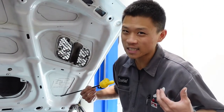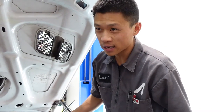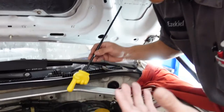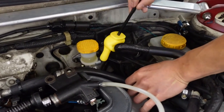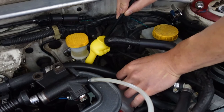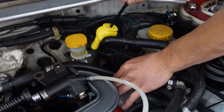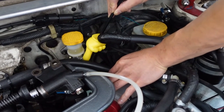What happened to me last time, which may be happening to you guys right now, is I could not get the system bled. No matter what, there'd be no pressure — no air would come out every time we pumped the pedal. Last time I did this, which is a good key indicator that something's wrong, we'd pump the pedal, open this up, and nothing would come out. No air, no fluid, nothing would come out of this bleeder — which should be impossible, right? You're pumping directly on the clutch master cylinder. This should be a direct path. Something's wrong if fluid's not coming out.